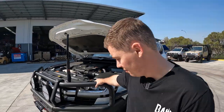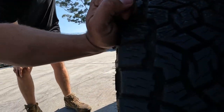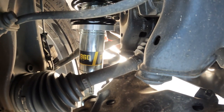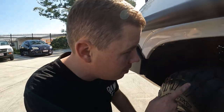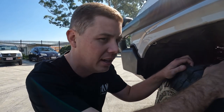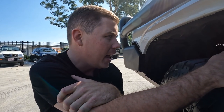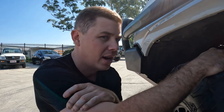Suspension - they are the new Bilstein V60s with upper control arms. They've got a little dust cap on top which you need a prying tool to pop off to grease - it is a serviceable, greasable item, so keep on top of that. Progressive coils in the rear, poly bag airbags in the rear with manual outlets. Tom's not going to be stupidly heavy all the time, so no in-cab air controls. They are looking at doing GVMs but it's not yet approved - still going through testing.